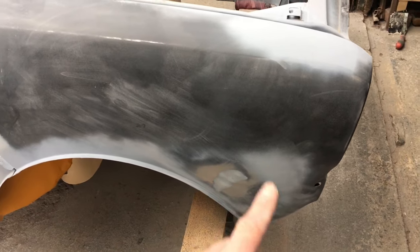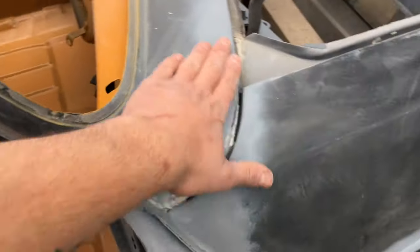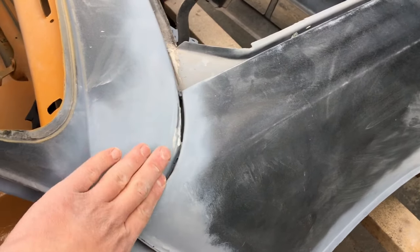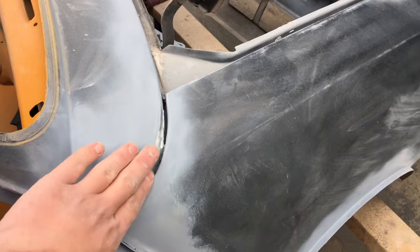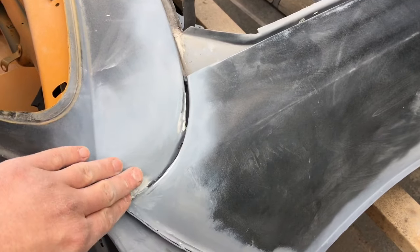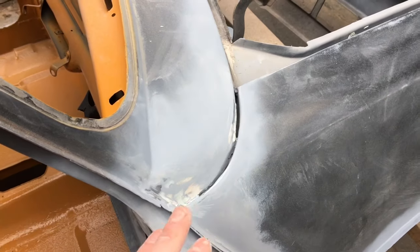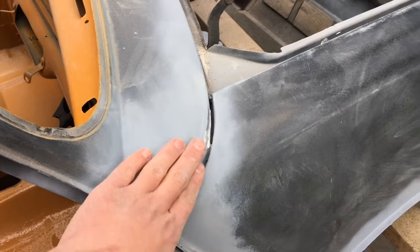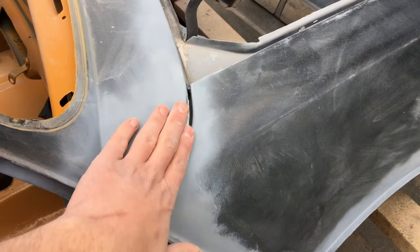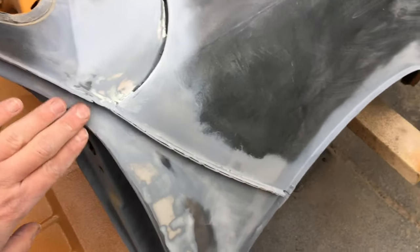There was a little dink in there. Again, that's sorted. This is where I did my repair, if anyone has wondered how it's turned out. There's a very, very small layer of dolphin glaze there, just to bring the profile completely back, but I'm really happy with that. So you can see where I've been priming it. I'm working out how it looks with primer on it before even going for full filler primer. So I'm using it out of a rattle can when I think I've got pretty close, and then going from there. Again, all this is really good.